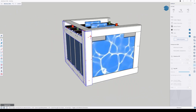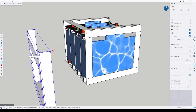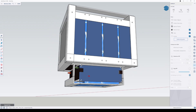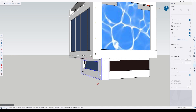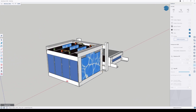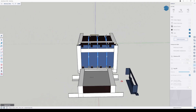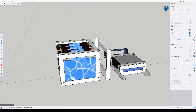An essential feature is that the front is actually a cover that can be removed. This way, the box can be constructed, filled with modules, and then closed up, as well as allowing for disassembly if needed. Once the main pack is complete, an additional lower section is created for a single small module below using similar construction. The lower module will also have a cover plate for assembly and disassembly. A mirrored version of the pack will also be created for the front of the car. The additional small module won't fit below it, so instead that module will be located in the gas tank area a few inches away. At some point in the future, the pack will have closing plates installed on each side to make them watertight.